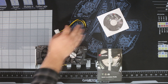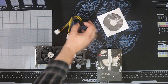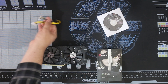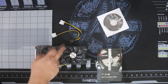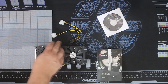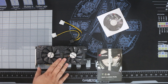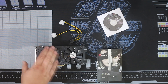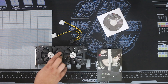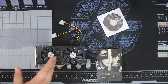This cable is a combiner cable — you connect two Molex connections from your power supply into it, and it outputs a single 8-pin PCI Express power connector to plug into the graphics card. The catch is I don't personally advise adapting power connections like this. We see no end of cases where people buy graphics cards, don't have the correct power supply, use these adapters, and then get blue screens in games when power consumption ramps up. The machine cuts out repeatedly and they end up having to replace the power supply anyway.